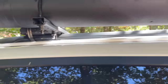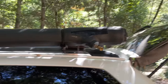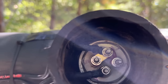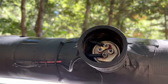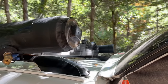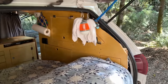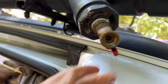On the roof rack I put crossbars to mount my solar shower tubes. This one is insulated because inside I installed a 12-volt water heater with 250-watt elements. I can hook up both elements or just run one to avoid a big drain on the battery. Generally I heat it while driving so I'm not using the house batteries. On the other side there's an identical non-insulated solar shower tube — both handle about four gallons. They have ball valves instead of regular faucets for a quick quarter-turn open and close.